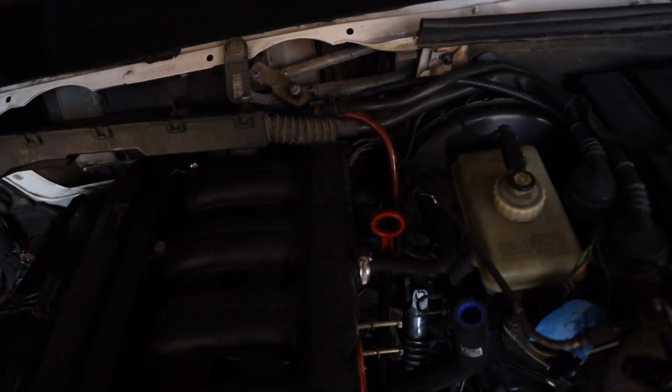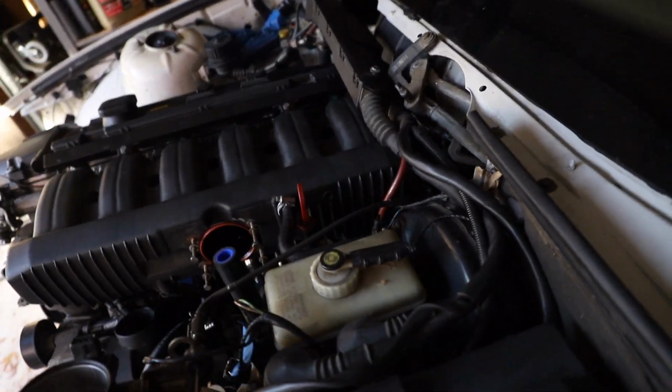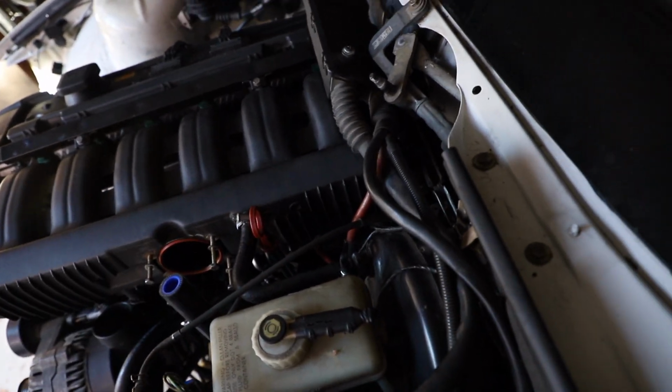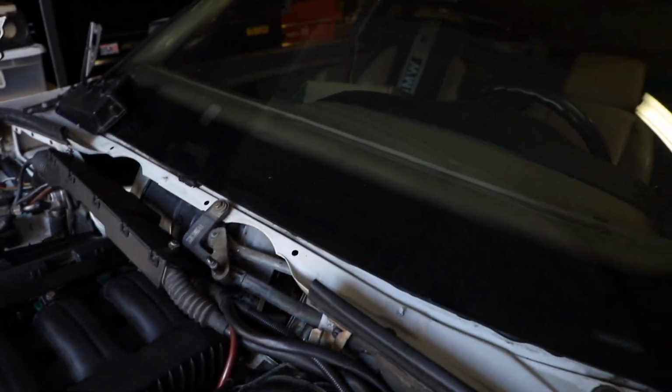And as far as everything else that comes off of the harness, the only other thing would be the wires for the starter. Unfortunately under the manifold, but you know where that's at. There's a ground and a power, and they go on top of each other for the starter. So that's it for this harness. This thing is connected, it's done.